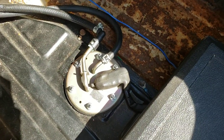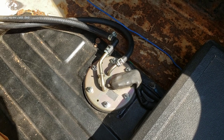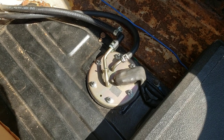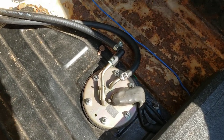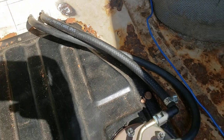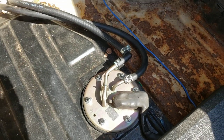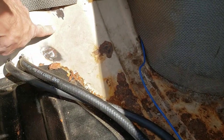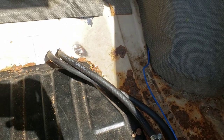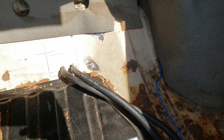This is how I did the fuel pump. I'm going to build a little wooden false floor for the trunk so this thing doesn't get banged into by all the junk I carry around. This is a 90s Honda Civic pump system and the lines go into some brass bulkhead fittings here. The pump is extremely quiet. On the other side of this panel you can see the studs — I mounted a Nissan EFI fuel filter in a generic coil bracket underneath there.